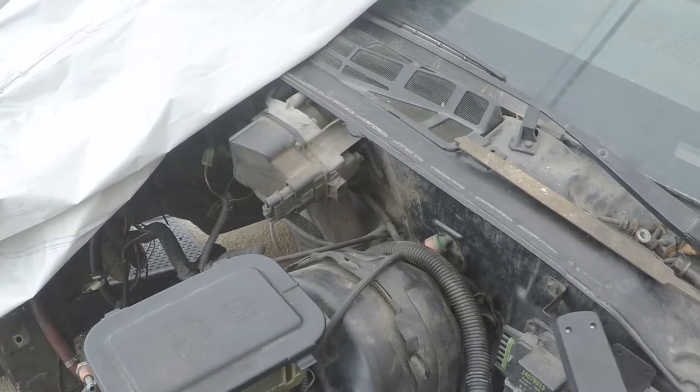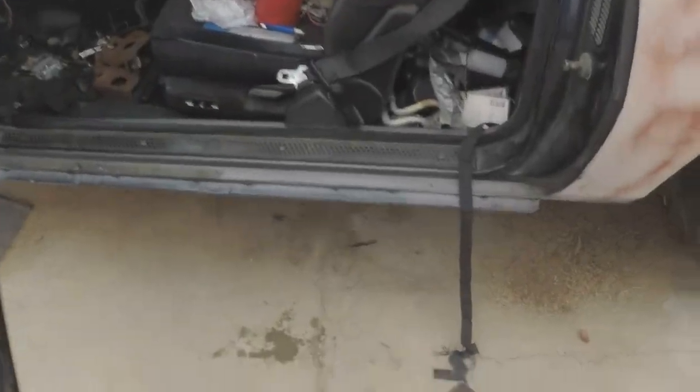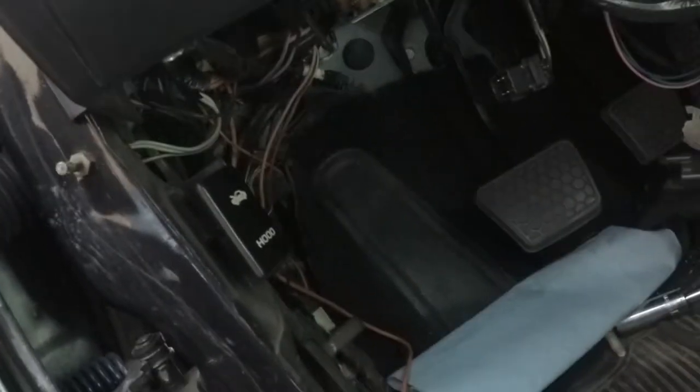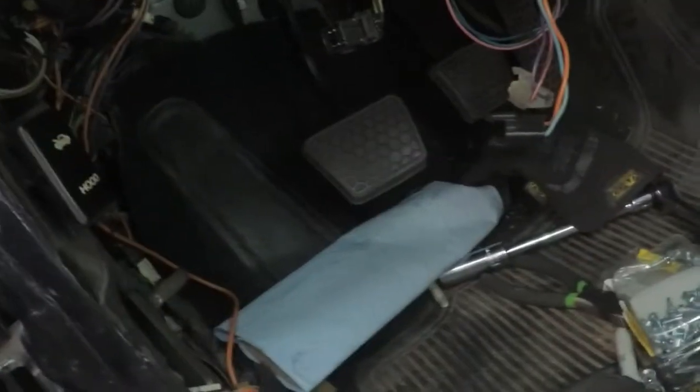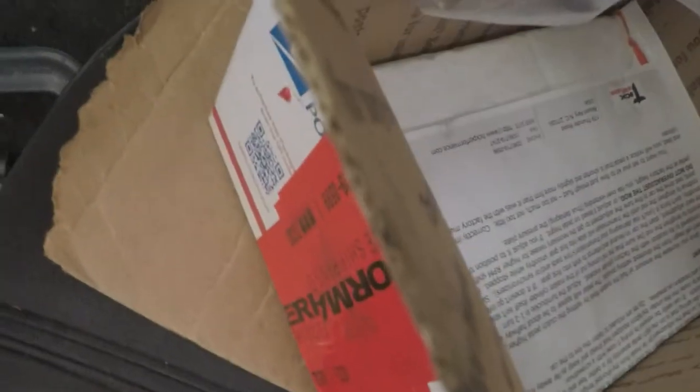What else did I do? Once I had the clutch master cylinder in, I put the brake master cylinder, or brake power brake assembly. I'm sorry, I'm so lost right now. I've talked so much. Power brake assembly in. You have to go to the little adjustable rod that's on there. That rod, I would recommend, as you're installing it, like putting it in, put it in with the rod already on. You get a set of instructions from Hawks Motorsports that tell you how to put it in.